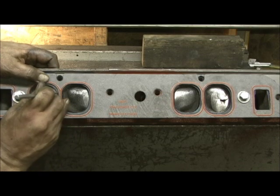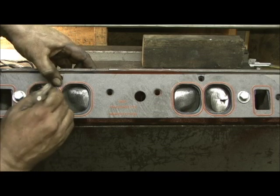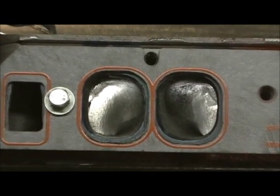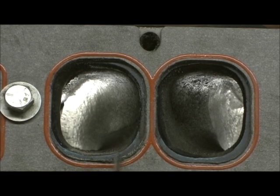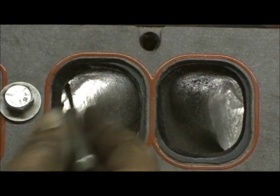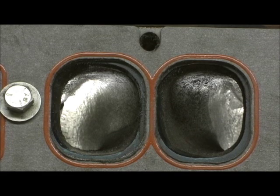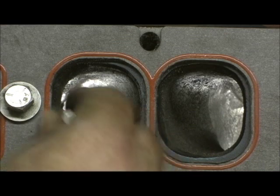It was pretty rough actually — very rough carbide cutter marks, and that's usually what you get. Thankfully, this gasket was able to straighten out most of it. With the gasket removed it's pretty easy to see. I've got a line right here barely touching it where they went in there and weren't paying attention to grind. But look at the gap from right there to right there — it's just right there on it. I'm going to smooth it and it shouldn't be a problem. It just barely cleared it by the skin of the teeth. Thank goodness Mr. Gasket had a giant oval that I was able to make this work.